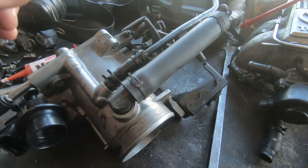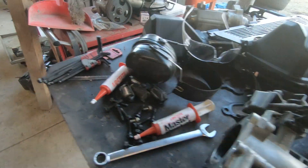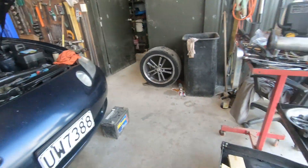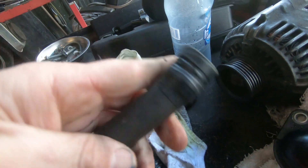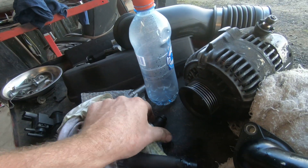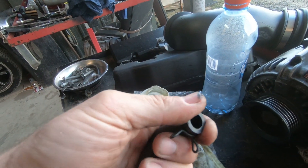On this vehicle, this hose here has just been replaced - the old one was taped up. Here it is - hard as rocks, with tape around it causing a little air leak that's not monitored by the airflow meter. That hose and the PCV valve - again hard as rocks. All those little air leaks can cause problems with your idling.